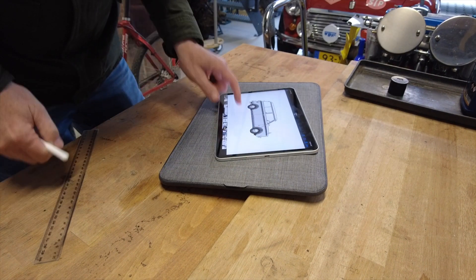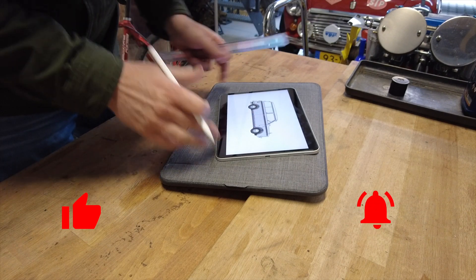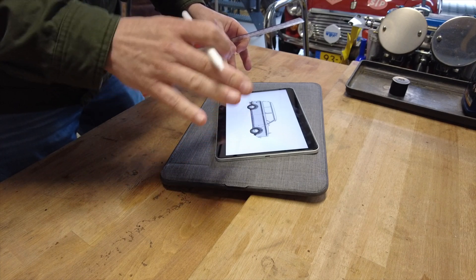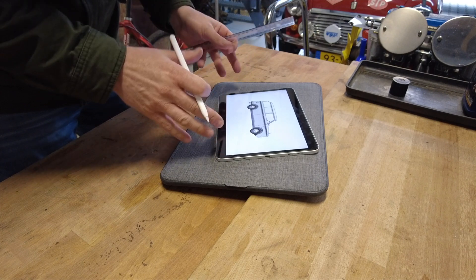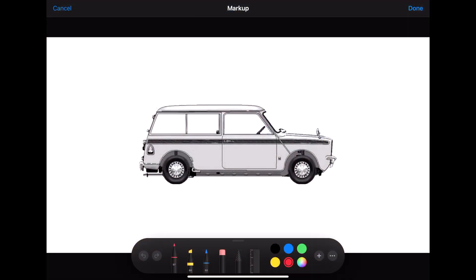What I'm going to do is try and illustrate the weight distribution using the iPad here. I want to re-emphasize I'm talking about weight distribution, preload and rebound — I am not going to get into wheel geometry in this particular session because that's a whole other topic. So first of all, let's take a look at the weight distribution. The middle of the car is roughly at the driver's shoulder, which gives you a nice split right down the middle. A Mini Clubman Estate has a bias of 65% of the weight on the front and 35% on the rear.